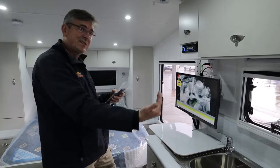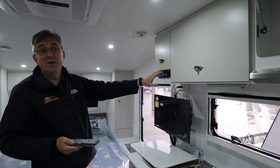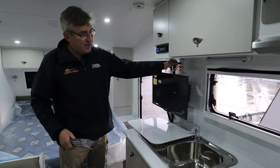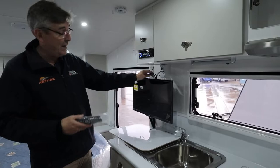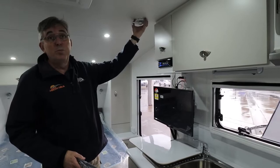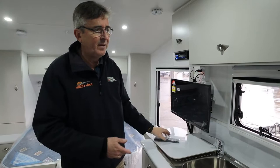If I wanted to use a DVD player on the back of my telly, I just choose the input or source and change it to DVD mode first - it powers up that part of your television to accept the disc. Don't just keep jamming discs in because once you get more than one in there, you're not going to like it. If you've connected on the A/B input on the back - we normally take these off for travel and put them back in the box. The best tip is to pull the power first so you don't upset any fuses by tapping a live power cord around. If you're using your rooftop antenna make sure that little light's on - if it's off you're not getting a digital picture. Now I better pack that antenna down because I've lined up the peaks.